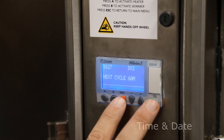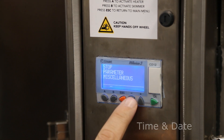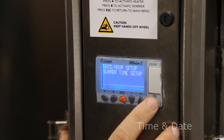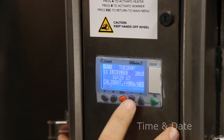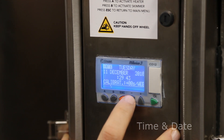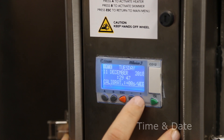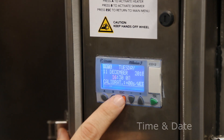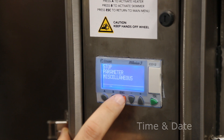You're probably wondering how we set the time of day in the machine. It's done very easily by following these steps. First press escape and OK simultaneously. Then with the minus button drop down to miscellaneous and select OK. Select clock and press OK. Select date and hour setup by pressing OK. The unit will start flashing on the seconds. To toggle around the various fields press minus — this will bring you to the date, to the month, to the year, to the hour. If you want to change the hour press OK and select plus or minus to change the setting. Always remember to press OK to save your settings. To get to the home screen press escape repeatedly and you will arrive back at your default home page.